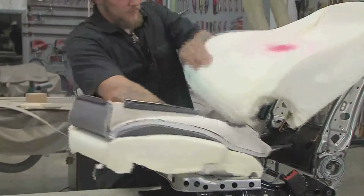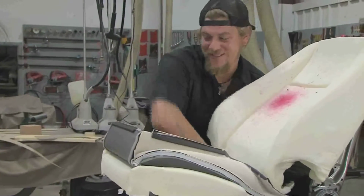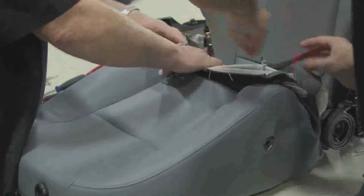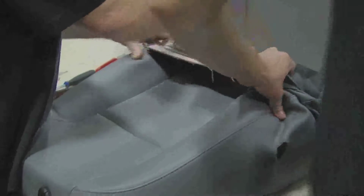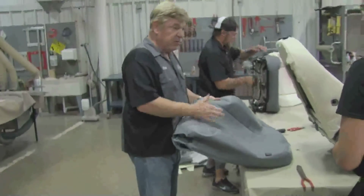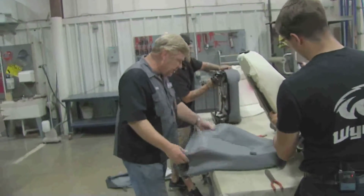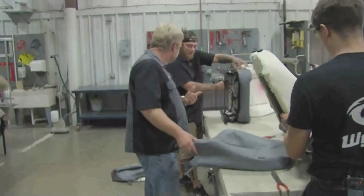And airbags can't go off right now, right? No, as long as the yellow cords are unplugged, you're good. The yellow cord, okay. Snip the blue wire and unplug the yellow cord. That's actually a really nice cover on there, but it just doesn't quite have that flare yet.